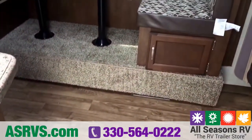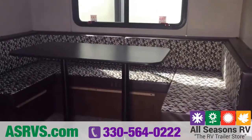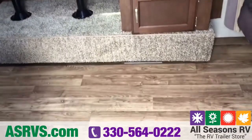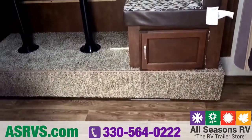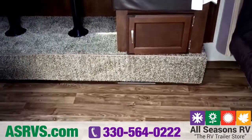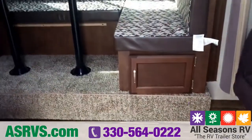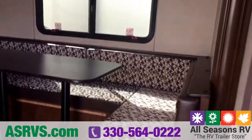Another thing worth mentioning about this unit is the floors. These are real wood floors — a lot of fiberglass units have laminated floors that over time can get really soft feeling. With these, you've got wood-look vinyl on top, five-eighths tongue-and-groove plywood underneath, and regular joists running beneath that. If you ever needed to make a repair, you'd just pull up the vinyl, cut out the affected area, and replace the plywood — with laminated floors there really is no good way to repair them.